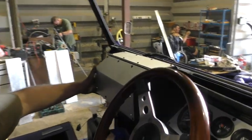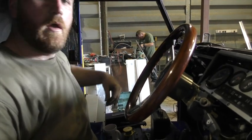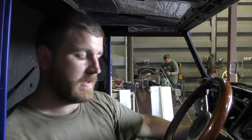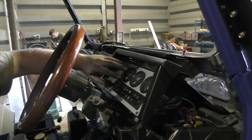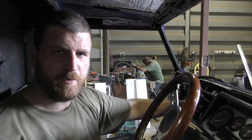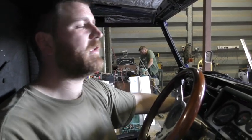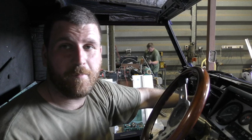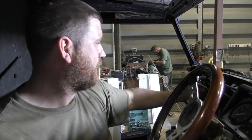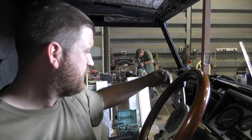One of the things we're having to do is move our temperature gauge and fuel gauge from the centre of the console back into the binnacle in the centre — all my wires are a wee bit short. It's a simple job; I just have to identify which wires are which, since it's been months since we unplugged them. I managed to get hold of a copy of the Haynes book — not very helpful. I've ended up tracing the wires from the top and doing a continuity check to the temperature sensor for the engine.